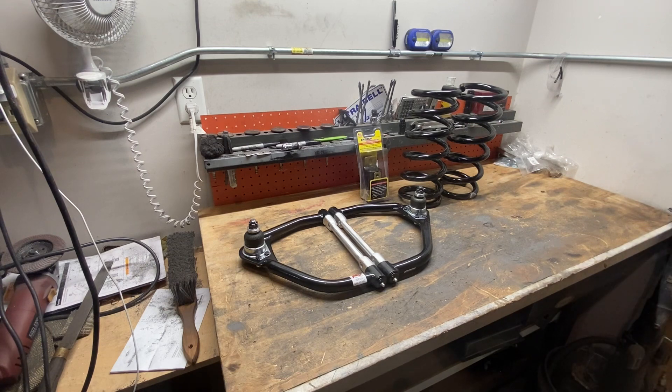What gets us in trouble is that on most of the forums I was visiting, a ton of people — I'd say 90% — were saying they ran the four-cylinder front coil springs with a V8 swap, and it lowered the front end about three-quarters of an inch to one inch. Let's just keep that in mind.